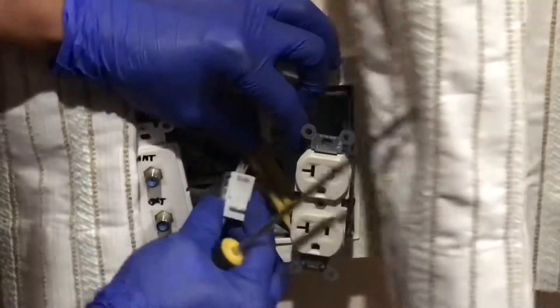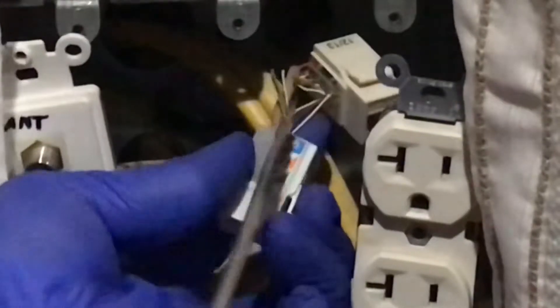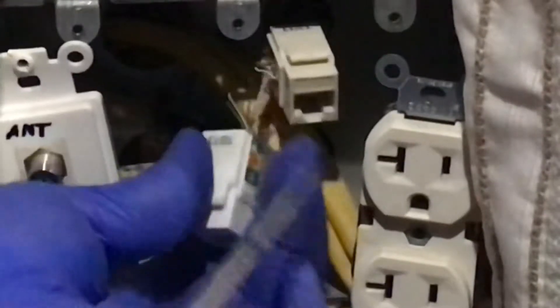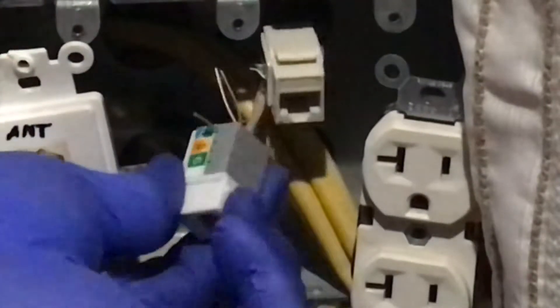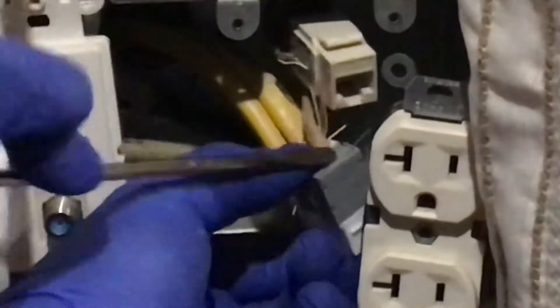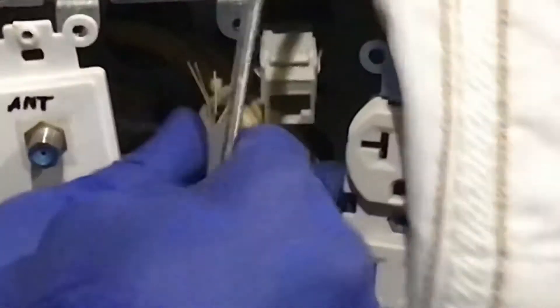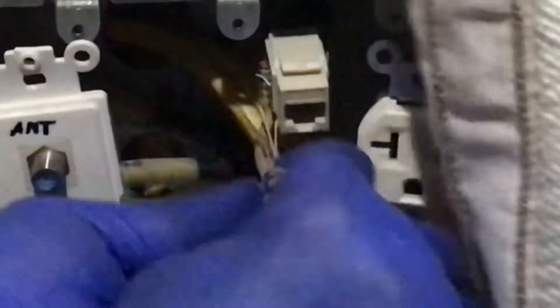Take the telephone terminal. Clear the protruding wires away to completely expose the grey telephone terminal cover. Now pry the cover off to expose the wires connected inside the telephone terminal. Remove the telephone port terminal by gently pulling the wires off of its individual connections.